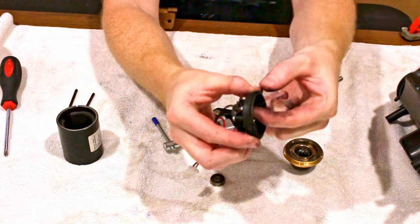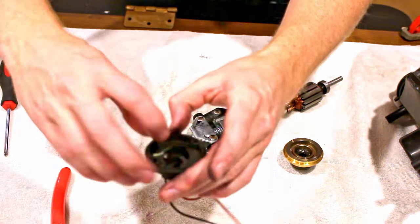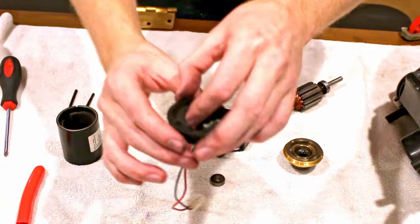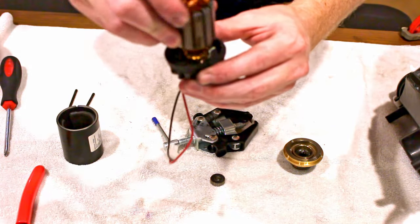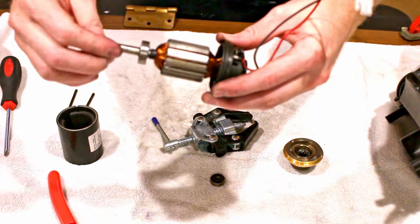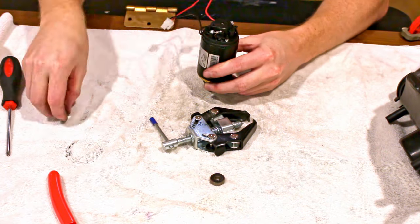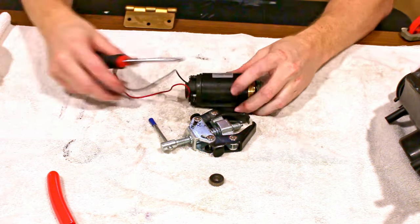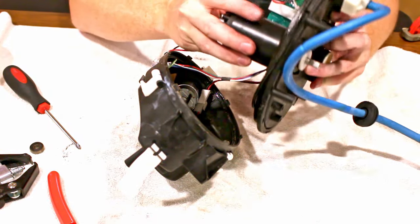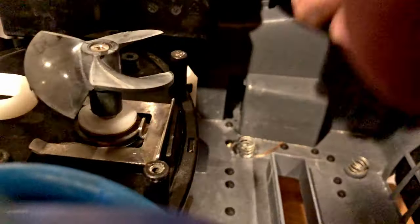The next part was a little tricky. Push the brush out from the inside to access the spring that keeps pushing it back inward. I used electrical pliers to move the spring off of where it normally sits so it wasn't pushing on the brush — that solved my problem and I was able to pop the motor back into place. This was one of the hardest parts of the entire project. There were a few notches that made it easy to figure out which way to assemble it, though getting the screws lined up with the brass top was a little tricky. Then put the motor back in the black box — don't forget to reconnect it. Now is a good time to insert the little motor clip; I forgot and had to do it much later.